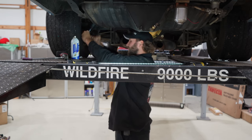Now I wanted to rebuild the old Holley double pumper because that's what the old timer had on this rig. And I really want to run this rig as close to what it was back in the day. However, that carb is shot. It's pitted and galled and it's in really rough shape. The jets are stuck in the thing. The sight glasses are rotted off in it. I'm gonna have to drill and get those out. It's too far gone. So I'm gonna throw that up on the shelf as a memory, maybe that's the word. And then put on something else that's gonna work for us.